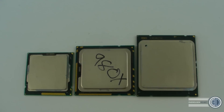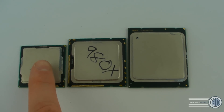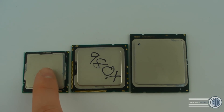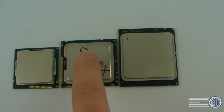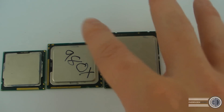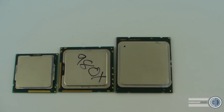With the 1155s you can get dual cores and quad cores; the top of the range goes up to the 2600K or 2700K — four cores, eight threads total. The 1366 goes up to six cores and 12 threads maximum, though they do make quad cores in that too. The 2011 processor for the mainstream also has six cores and 12 threads, but there are Xeons with eight cores and 16 threads.